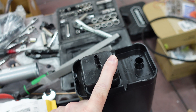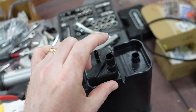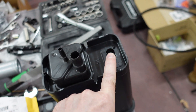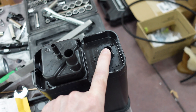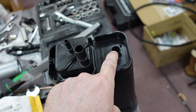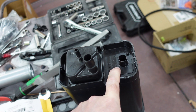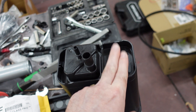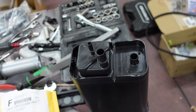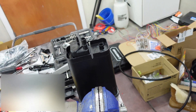Part two is this line here, which is the vent line. This is the one that Pops and I were going to work on today. This has to go all the way back to the tank. I'm curious on your car if there are any valves or anything along the way. We're going to be putting a rollover valve in there, but what else might be there? And then number three, the E-Rod instructions do not call for anything on this port right here. This is the vent-to-air port. This canister is from a C5 Corvette, and on a C5 Corvette there is a vent solenoid where you can control whether this thing vents to atmosphere or not. The E-Rod does not come with that as far as I can see, and there's nothing in the instructions about it. So it seems like you leave this open — but if you leave this open, you can't seal this system, so you can't do the vacuum tests. Pete, those three lines — if you can find where those go on your car and where this canister is, that would be really helpful. Let me know.